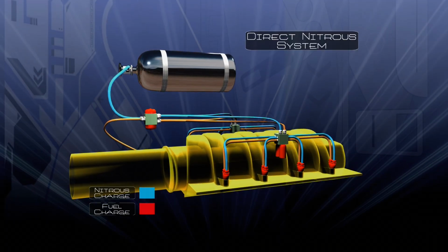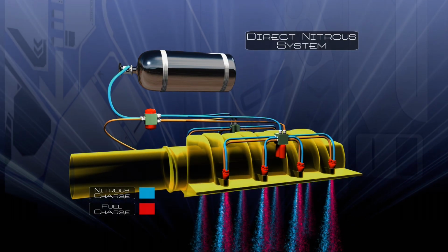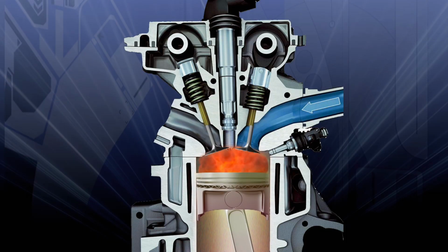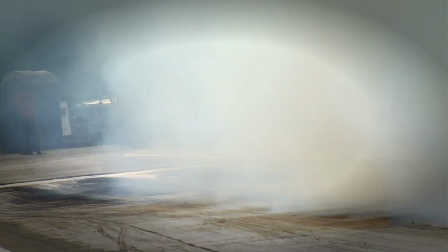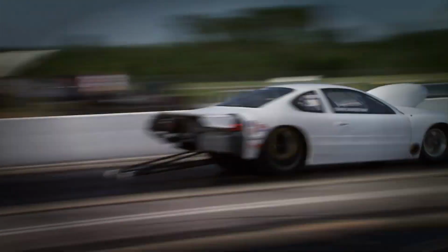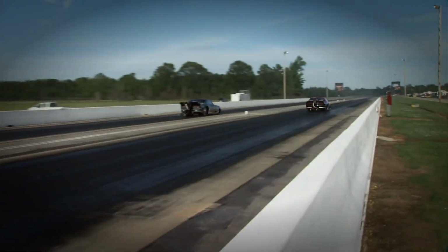The principle has always been the same. Stored as a liquid, it evaporates in the intake manifold, dropping temperatures and creating a denser charge, with more oxygen so more fuel can be burned. Maybe the biggest boost to its popularity was the advent of drag racing classes like Pro Mod. Suddenly, stock-bodied door slammers could spray their way to 6-second quarter-mile runs at over 200 miles an hour.